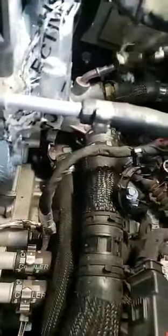It's gonna make a mess and that's all right. Here's your thermostat — I'm gonna take these lines off. That line just comes out, you're not putting that much pressure on it, just barely push it and it'll come off. This clip right here is from the last hose down back there — I like to use these pliers, I call them my fingers. Pull it out so you don't lose it or damage it, take it out and put it somewhere safe.